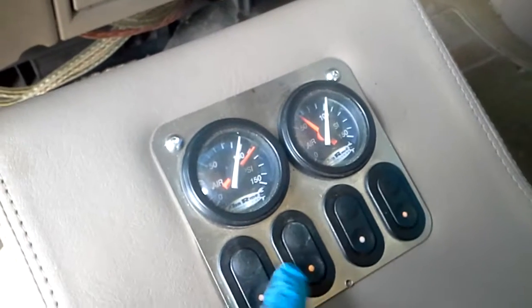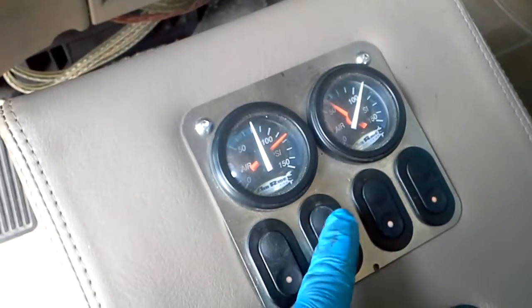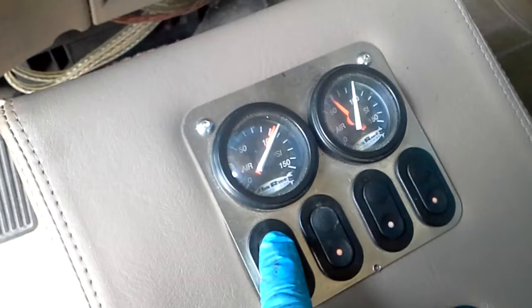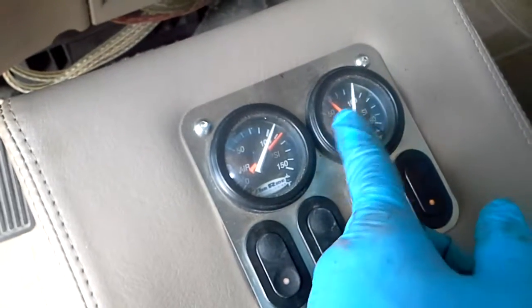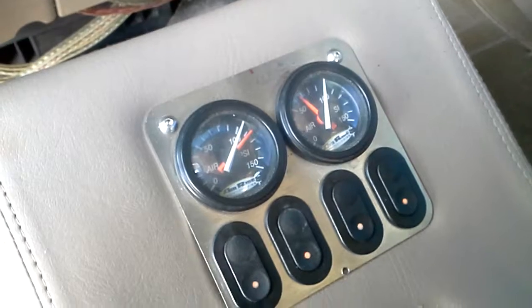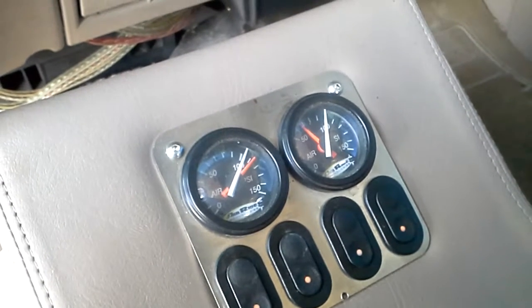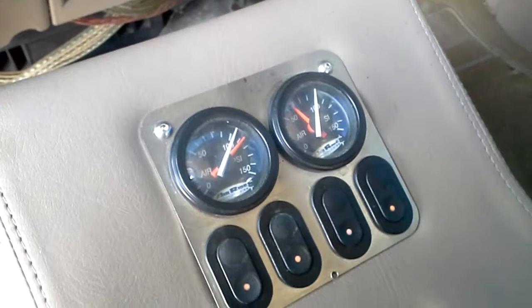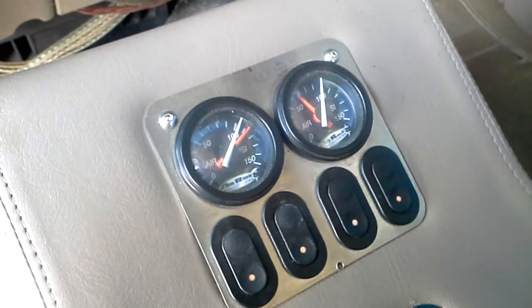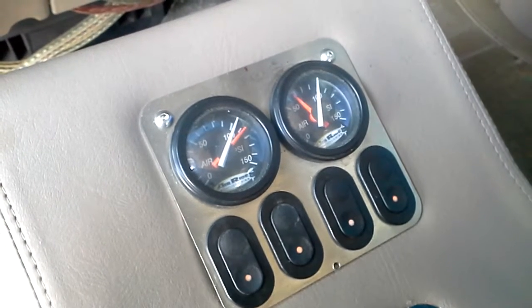I use these buttons to raise or lower the vehicle — press it and the vehicle goes down, release and it goes back up. That's the left rear, and likewise over here for the front left. Orange for front, white for rear. It's a pretty reliable setup. The reason I chose to go with air suspension is simply for a better ride quality versus a coil spring or leaf spring setup. You can go with air springs, air shocks, or air struts — it depends on your application, your imagination, and the space available in your vehicle.